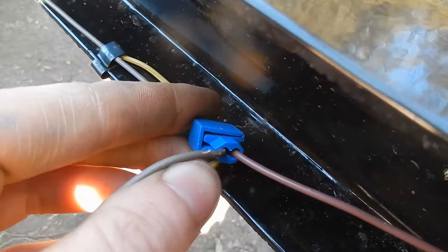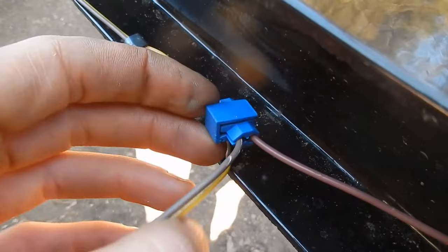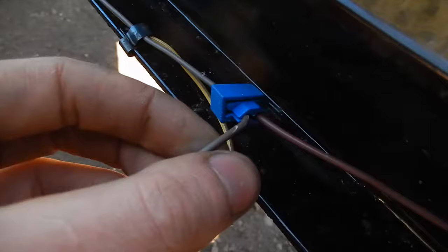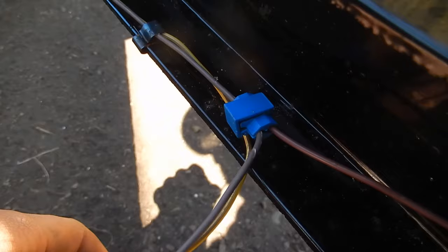They give you these crappy guillotine-style connectors, which are probably not automotive connectors because they're all open to weather and rain and everything and salt. But I use those and they don't work at all. They must have sheared off a piece of insulation between the connections, so it's not making a connection from power to the light bulb.